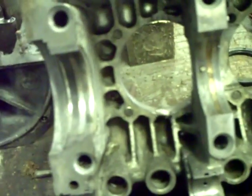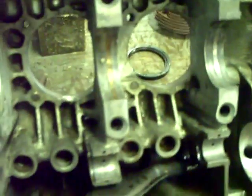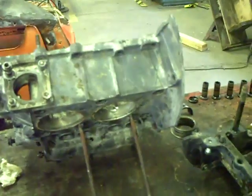There was something else that made me wonder whether this was the original. Oh yeah, the thermostat is missing. Somebody went to the trouble to take the thermostat out of this thing. Of course, somebody could have done that while monkeying around with something else. But we're going to have to get a thermostat for it, because I don't care what kind of engine you run, you need a thermostat. It helps the engine get up to operating temperature as quick as possible, and the quicker you get an engine to operating temperature, the longer it'll last. When it's not at operating temperature, the lubrication and everything isn't right, and it's going to have more wear. People with air-cooled Volkswagens seem to insist on taking the thermostat out, and it's just not a good practice. So we'll have to find a thermostat for it when we put it back together.